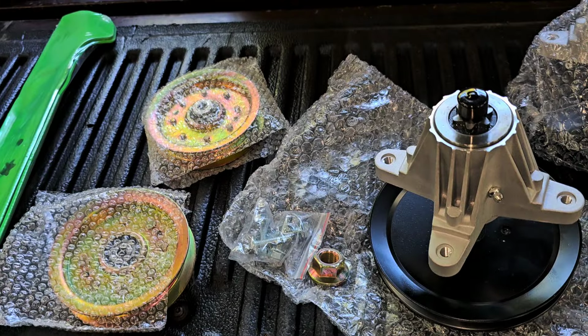So it came with all of that. So I figured I gotta fix this thing, because it's really cutting awkward on the grass, because I raised the height. If I have the height at just a very low level, it cuts perfectly even. But if I raise it up, because this one side sits low, it has a tendency to dip and it creates lines in the grass. And of course it's not very sightly, but it is what it is.